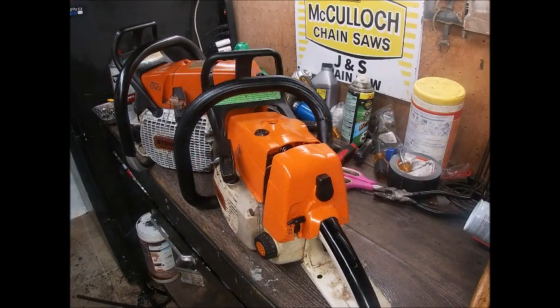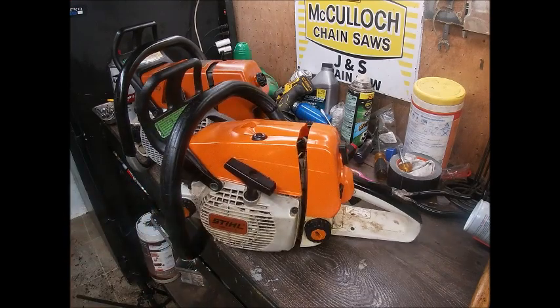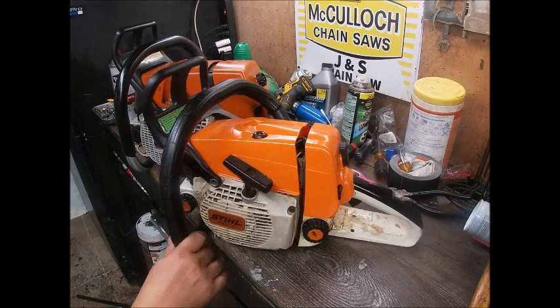It pulls chain well. I will say I did go back into it last night and pull the top end off and throw in a thinner gasket and actually decked a couple thousandths off of the base. When I first put it together, squish was around 27 thousandths, and it ran good there, but I pulled it back down and tightened it up just a little bit. I've actually got a video of before and after, and you can really see the difference. It's just funny what a little bit of compression does for one.